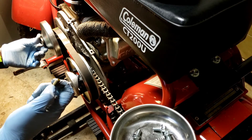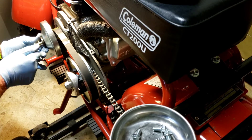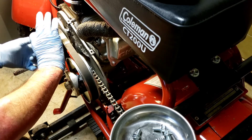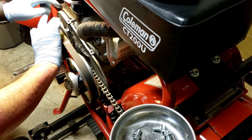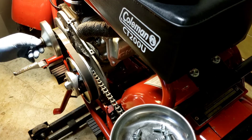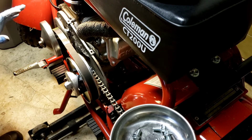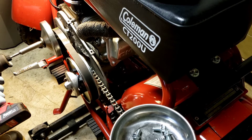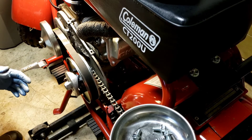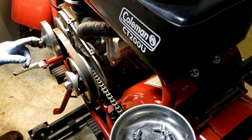The retainer they give you is about that much shorter, so you're not fully engaging your crank threads. The flywheel is held on with a cheap nut torqued to 54 foot-pounds, and the side cover bolts go into aluminum at 17 foot-pounds. So this bolt could easily be torqued somewhere between 17 and 54. I'm real big on torque specs, but for this I just go as tight as I can get it without stripping it — tighter than 17 but less than 54, that's what I can tell you.